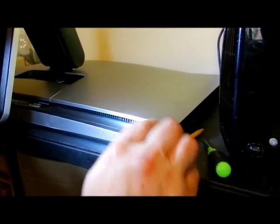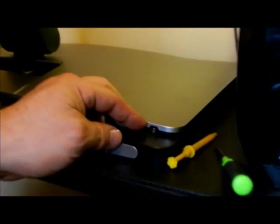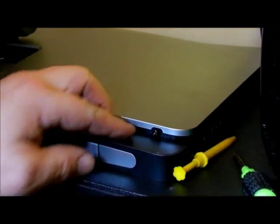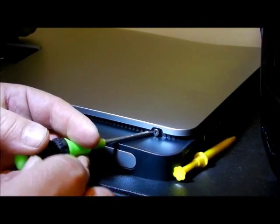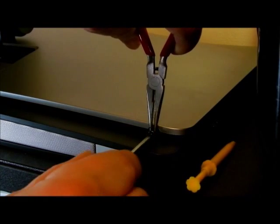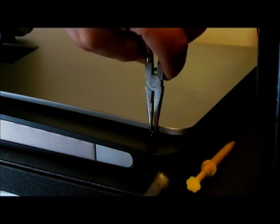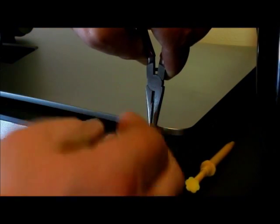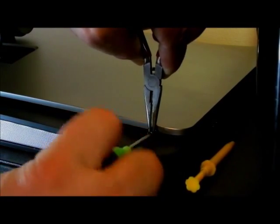Okay, this is how you take the back off. There are little screws right here — this is hard to see and I'm trying my best to get you in there. It takes a long time to get this out. It comes out like this, and you think that's it because it moves around, but it's not. I'm using this as a pry nose right here — be careful you don't damage the computer. I'm pulling toward me while doing this, so I'm not cranking down on the screw. I'm on both sides of the head pulling toward me — put some pressure on the screwdriver and just back the thing out.